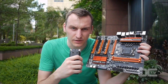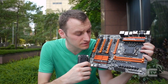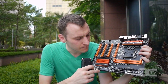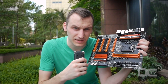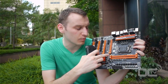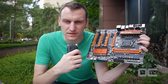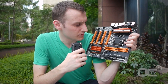You have all the remote controls here for the OC panel. The OC Ignition allows you to boot the mainboard and have everything running except the CPU — useful when you have cold boot or cold bug issues. The tag feature lets you tag profiles directly in the BIOS to increase CPU ratio or base clock. They also added DIP switches so you can disable PCI Express lanes, and you can also disable one of the DIMM slots — so if you want to overclock on just one memory stick to reach the highest frequency, you can deactivate the second slot.